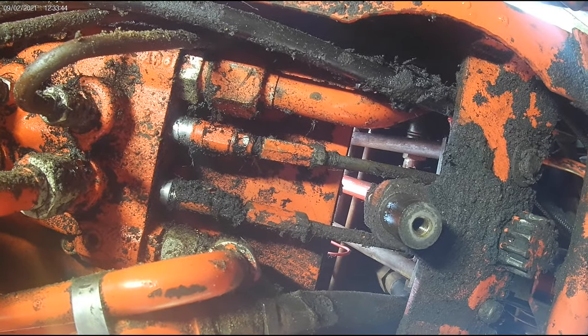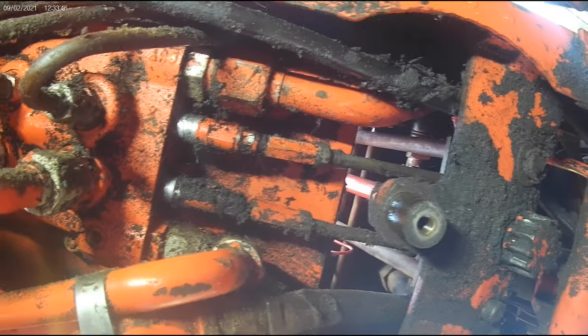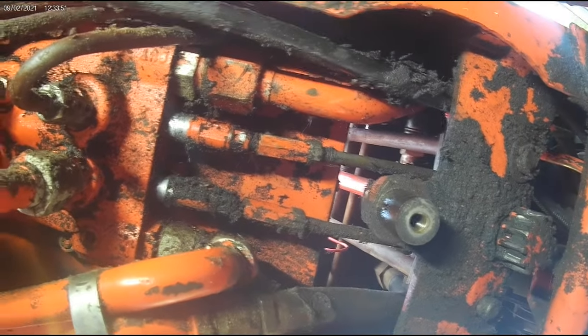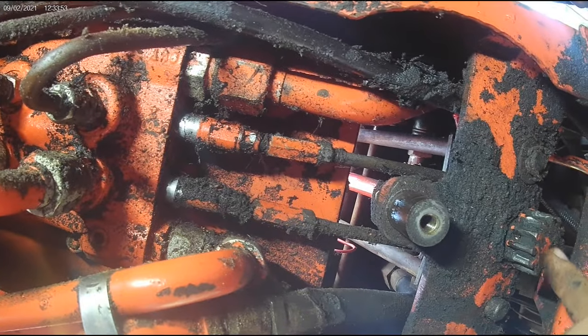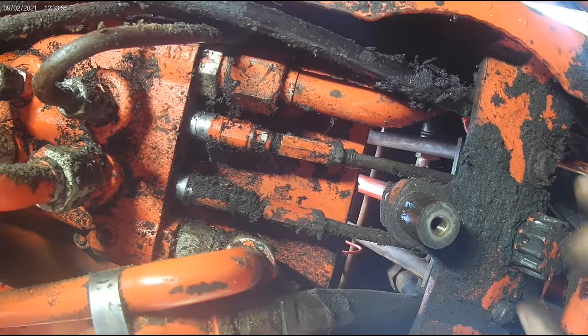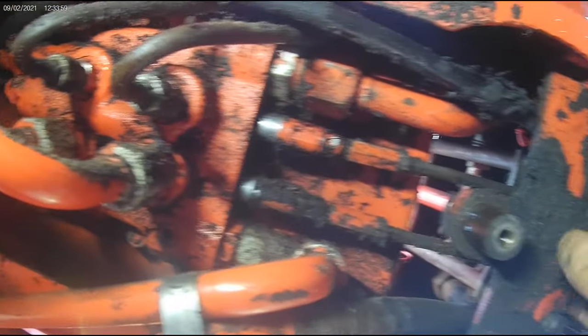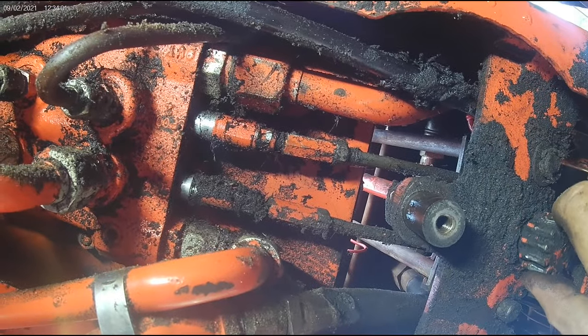Usually people try to take the steering wheel off, but that ends up being a disaster because they don't come off very easy most of the time, and the steering wheels get wrecked. So a lot of guys find it easier: you grind the spot weld off the bottom of this gear, and slide it off, put a new one on. That's not too bad of a project, but I think we can get by with a new moon gear on this one.